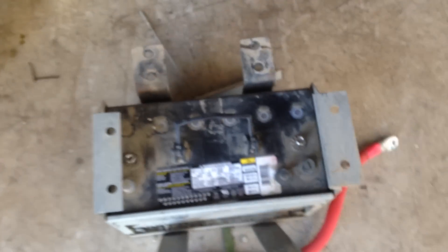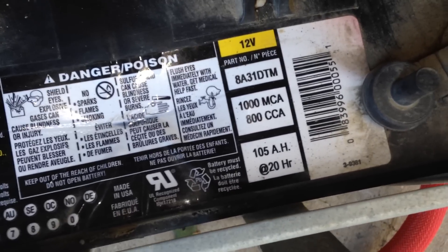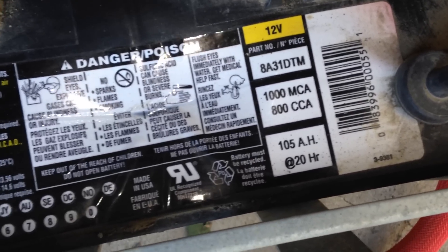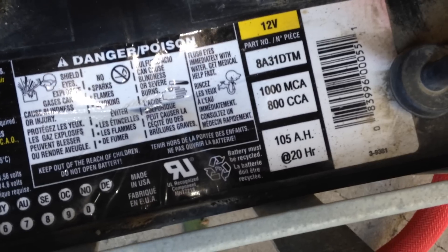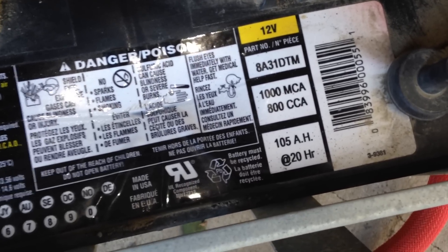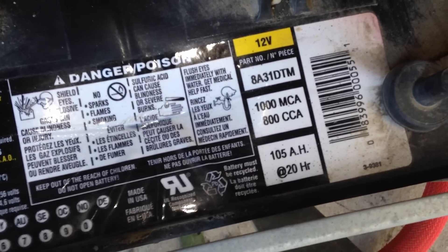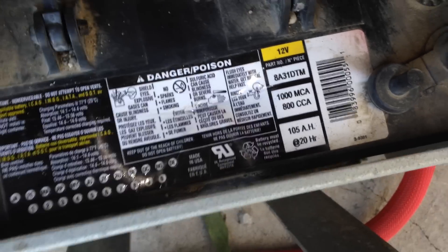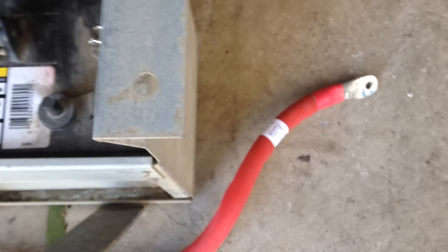I took out the battery hanging under the carriage. This is the 105 amp AGM battery that weighs probably about 70 or 80 pounds. It puts out 105 amps but you really only get half of that, so you get about 50 amps of life out of an AGM battery. It also has 800 cold cranking amps, which I think is the reason the single AGM battery worked where my single lithium iron did not. They also use very heavy cable — that's a 4-0 cable that Roadtrek uses underneath the van.